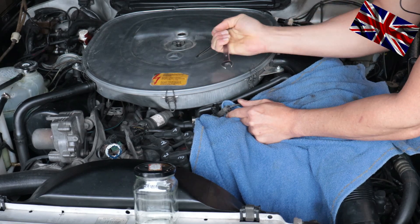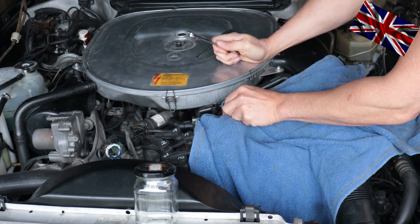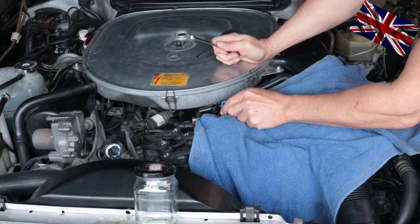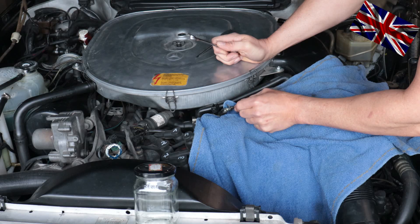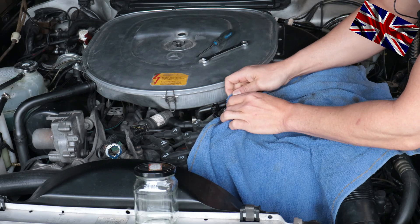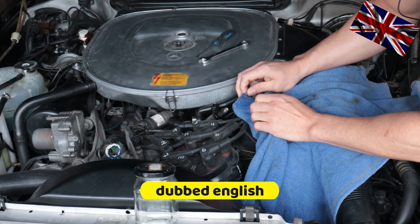Use an old cloth which will absorb the spillage of the fuel — some fuel will exit here. If you are already working on your electro hydraulic pressure regulator it comes in quite handy, since this part is under pressure as well. Unbolt the fuel line carefully. We were lucky: very little mess this time, just a couple of drops of petrol. Even better.